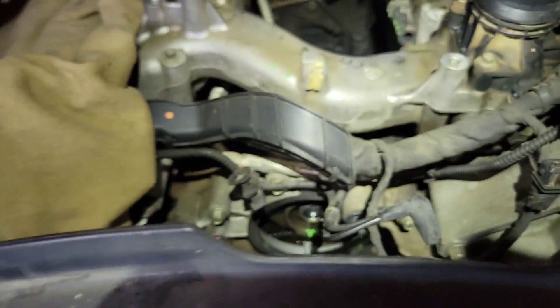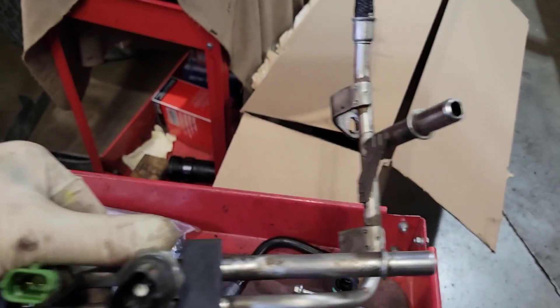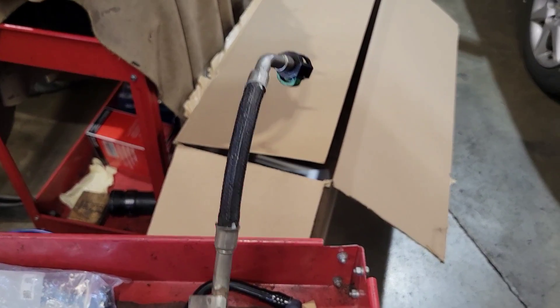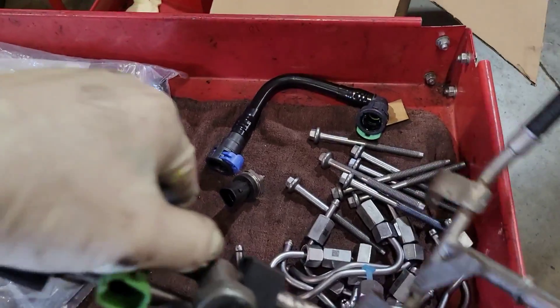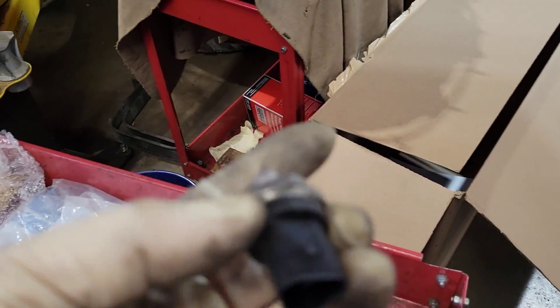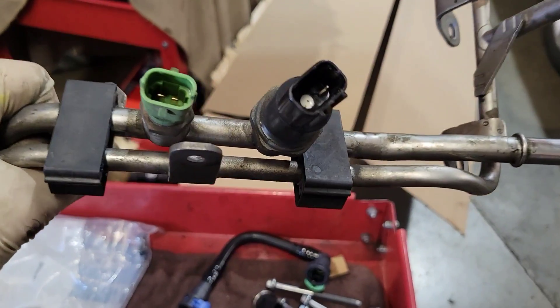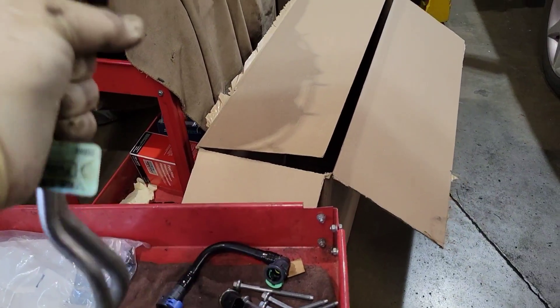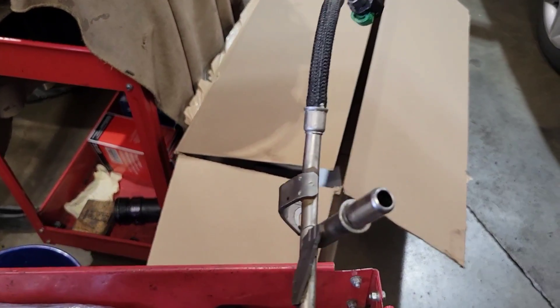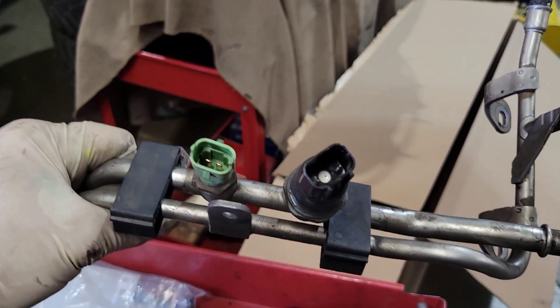Here's what your old low supply line looks like — it has two two-wire sensors. My fuel contamination kit ordered by VIN came with one spot for a sensor and a four-wire sensor, which was the wrong one. It took several phone calls with Ford to confirm that. They're overnighting the correct one. If you have this problem you need to go back to Ford and get it figured out.